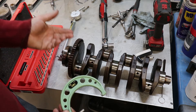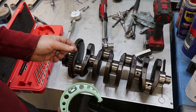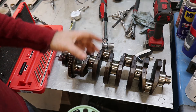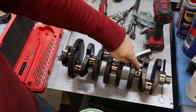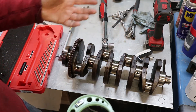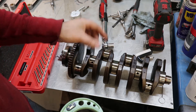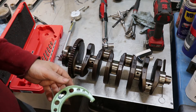There are a few ways you can do bearing clearances. One way is plastigauge, which a lot of people might be familiar with. It's a little thin rod of plastic — you break off a little piece, put it on top of the bearing journal, and then do a dry assembly with no lubrication, bolt everything together and torque it up. That little plastic rod will get squished and as it gets squished it gets wider. Then you take it all apart and there's a little gauge that shows how wide it got, indicating how many thousandths of clearance there is. It's reasonably accurate, but not super accurate.